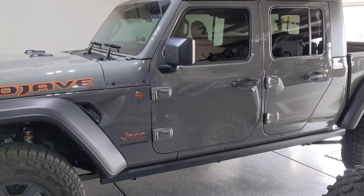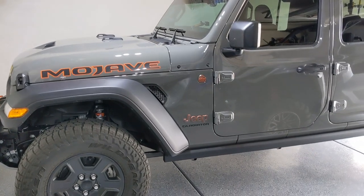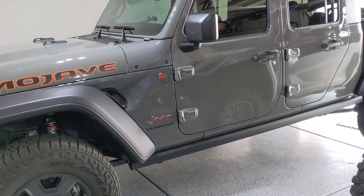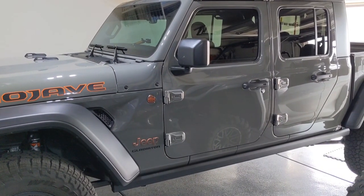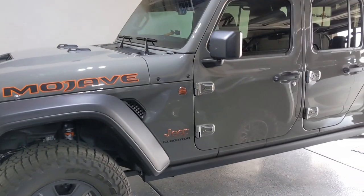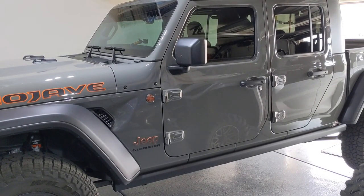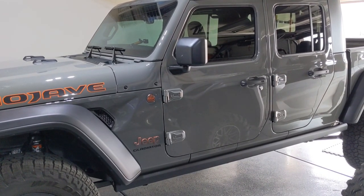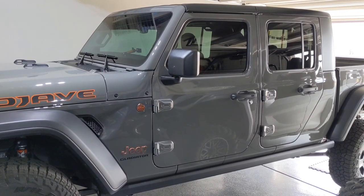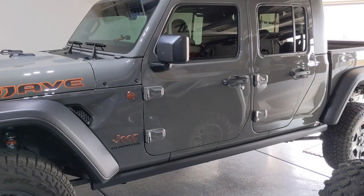Got it all buttoned up — this is actually the day after. I had it all set but wasn't 100% sure I liked where I had the valves, so I drove it around all day yesterday to see how it felt with the bags in before deciding to relocate the valve. I drove it all over town — bumpy roads, highway, city driving — multiple conditions, multiple stops. There were zero characteristic changes in the way it drives with the airbags at five PSI, which is what they recommend to keep in there for maintenance of the bag. When you're going to tow or carry a load, inflate to the needed pressure up to the maximum of 35 PSI.